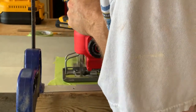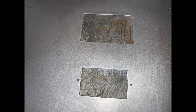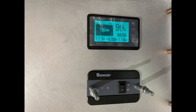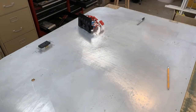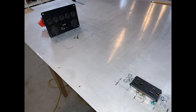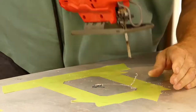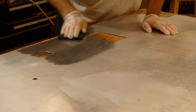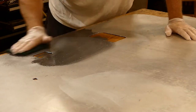Here I'm cutting holes for our Renogy battery monitor and our Renogy 2,000-watt remote inverter switch. I've placed these in a position where they can easily be read from within the cabin, as well as by the person sitting in the passenger seat while driving to check the charging status. Next item to tackle are the 110-volt plugs, and the switches and USB panel. I used a jigsaw with a little tape to protect the aluminum face. With all holes cut — including the water supply line and future cabinet mounting holes — we are now starting on our polish work.